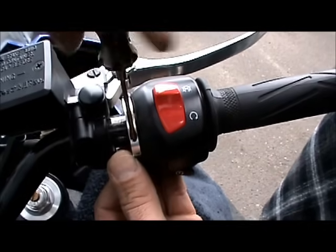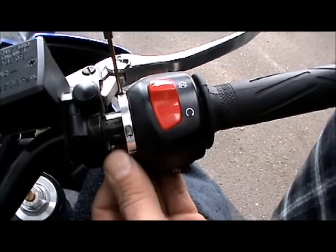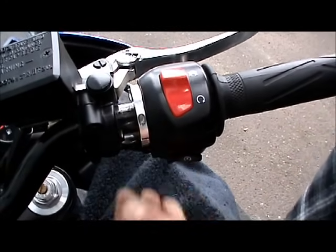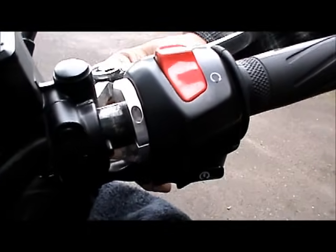You don't want to tighten them at this point. Just snug them down so that the gap on each side is equal. And you still want to be able to rotate the support up and down.